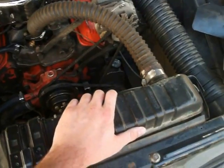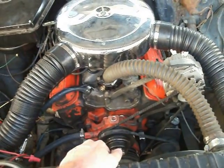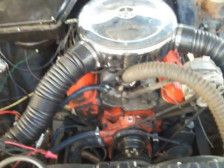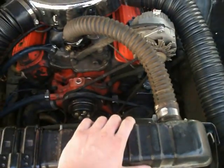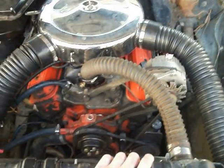This radiator is a huge radiator — about twice the size of a normal one. This truck used to have a 283 in it stock, and those were notorious for overheating. It was also meant as a tow vehicle, and tow vehicles overheat more, plus those 283s had issues. So they put this massive radiator in here, and I don't overheat at all.